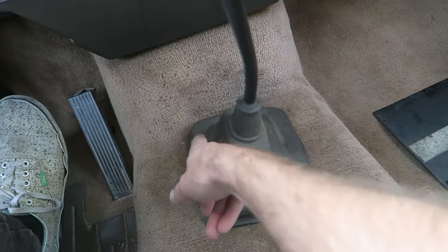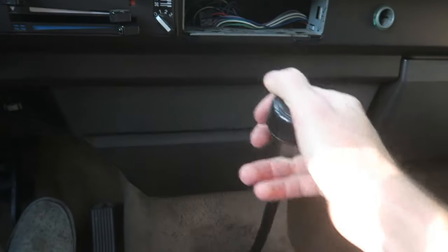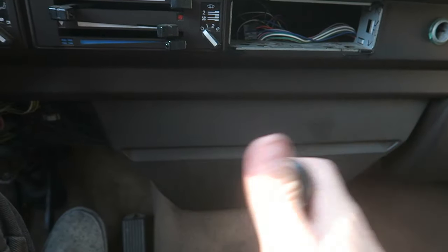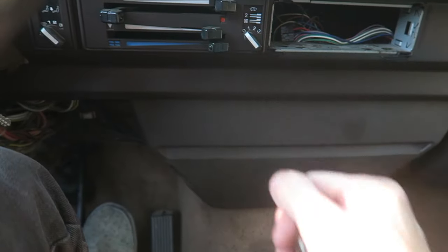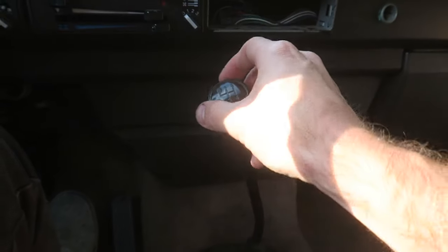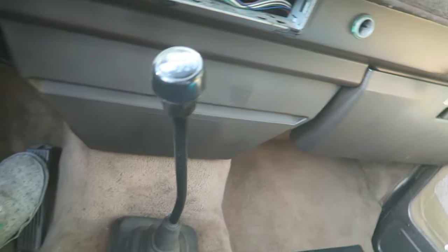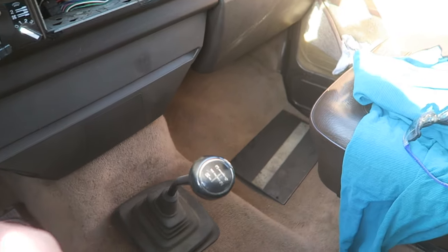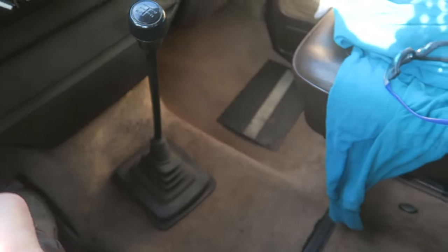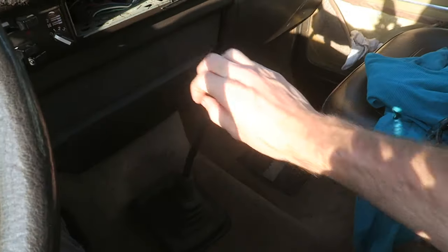I'm on my first test drive right now. I went ahead and had to loosen this nut right here — there's one on the other side — and twist the whole assembly to the left. Other than that, as you can see: first, second, third, fourth. First is a little smoother. Reverse — everything goes in smooth. And not nearly as much play. Here's in gear — it's like no play almost. So way better than it was. There's first, there's second, there's third. Super direct compared to before when it was kind of like guessing where you're putting it. And there's fourth.